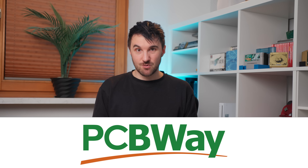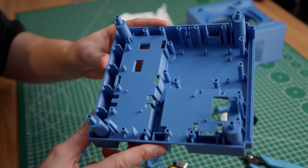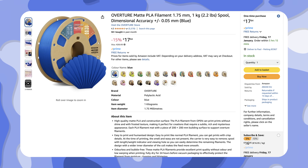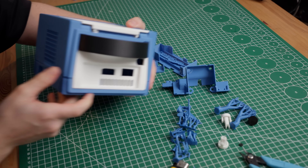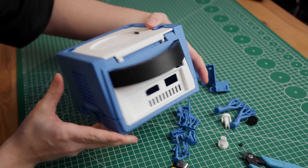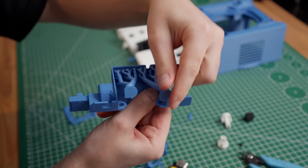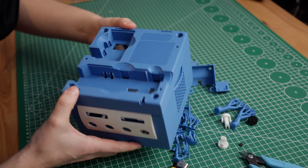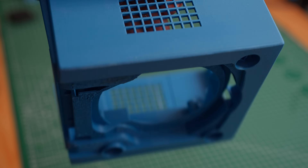Now let's get right back to the 3D printing, and let me tell you — this took a while. In total I spent around 23 hours of printing time to get all the parts out, and that's with my new A1 Mini. My old Ender 3 would have needed two to three times as long. I chose to make the GameCube themed around my channel using blue PLA from Overture, and also tried out their Super PLA. The idea is to have the shell top and bottom in blue, with the lid, controller port, and back panel in white. After cleaning up all the support material and doing a quick test fit, I used a deburring tool to get all the sharp edges off. It's also good practice to put a lighter to the edges to make rough edge lines disappear.